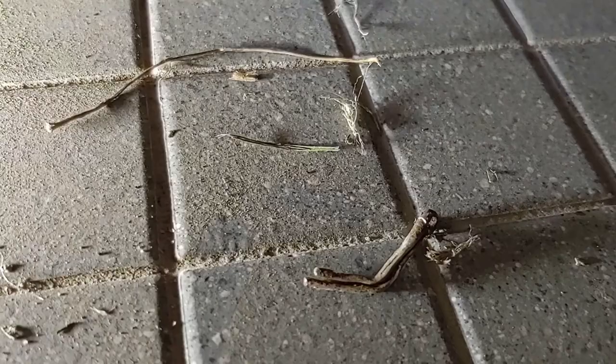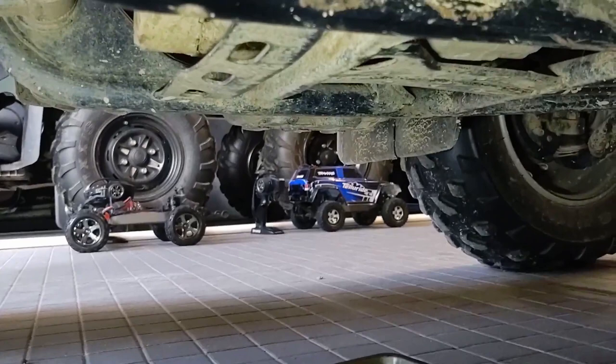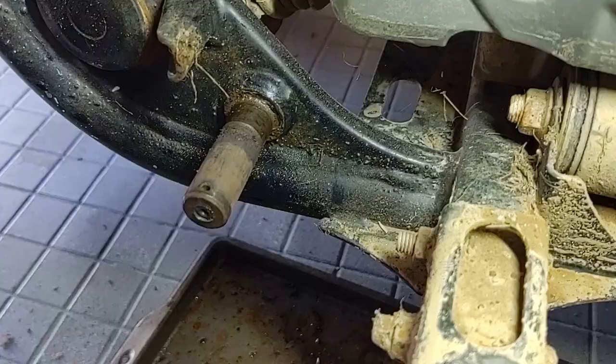The cotter pin did not make it — this is a pin I probably would have reused. There are things I will not reuse: cotter pins on brakes. These are a little more important. This one did not make it, it's going to get replaced. Let me get a little WD-40 in there. Put my little pan there to keep the tile clean — four boys, garage floor. We're going to get a little WD-40 on there and see if that will help loosen it up.